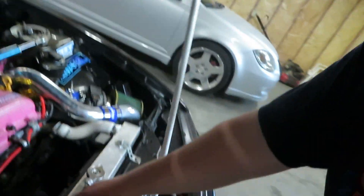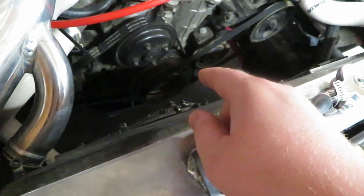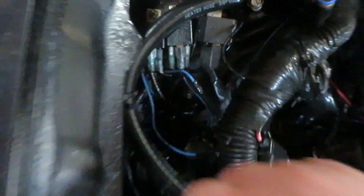Let's get back to the 240 and look at some stuff. A lot of this car was done when I bought it, but something negative — these electric fans were in. These are Flex-A-Lite fans, they're really nice and they keep the car cool. But something I thought was really dumb: the relays are run through speaker wire from here to here. That's not NeverSlow — the guy who got this car from NeverSlow did that. I ended up replacing it all with better, thicker wire.